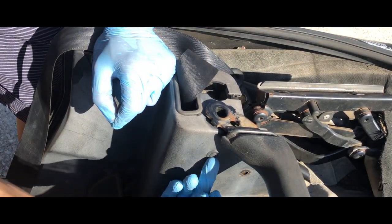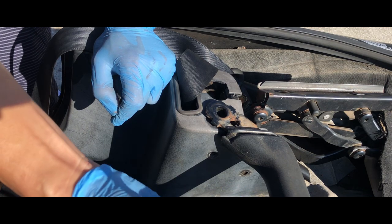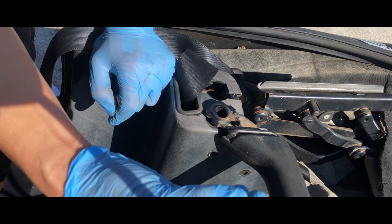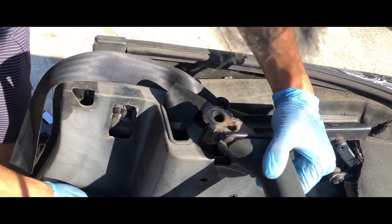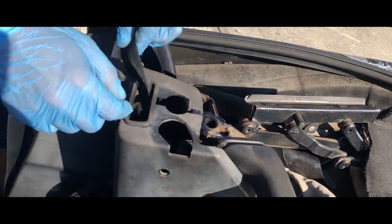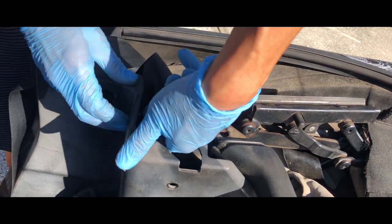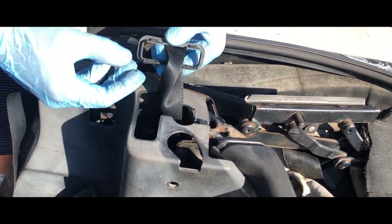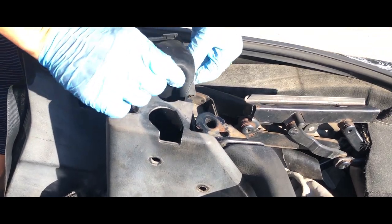There's a little pin right here — you can put your fingernail under it on both top and bottom and slowly pull this out. If not, you can probably use a really thin knife or flathead screwdriver, but be really careful so you don't destroy this — it's just plastic. This lifts up, and then this just wiggles out of the way. You lift this and pop this little rectangle pin off. There are four tabs — you push those tabs in order to release it. Now you can work the seat belt through. Right here it detaches — there we go.